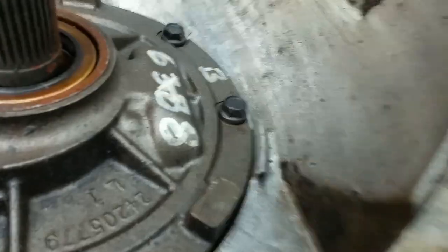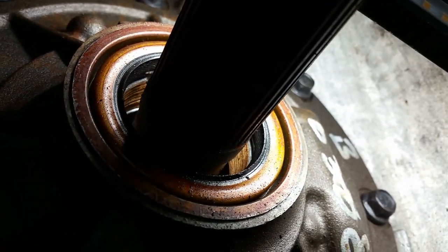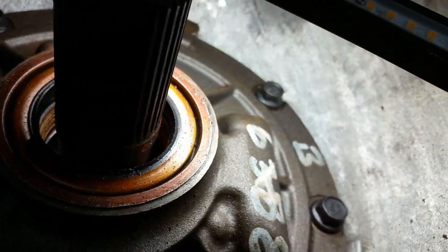I did some preliminary check on this last night, just looking at this front bushing for the torque converter. That thing is torn up from the floor up — it's not supposed to have all those grooves in it like that. Usually what that's caused from is lack of fluid pressure. My guess is this thing's going to have a broken pump in it. It's not as common but it does happen where the crescent moon and gear will crack. Usually what causes it is when the torque converter slides out of its groove just enough, and it's not reseated before you put it back in. When that happens it puts extra stress on the pump and it'll destroy the pump.